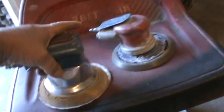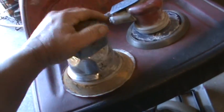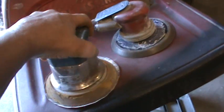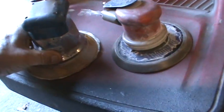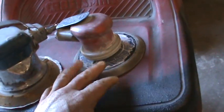This is what I started out with — this is a Hutchins, and this used to have a handle on it. They make a blue one and a red one. I believe the blue ones are more aggressive and the red ones are for finishing. What they mean by that is there are different oscillation patterns as far as how much it throws. This is more of a finishing DA compared to this one — this one is an animal.